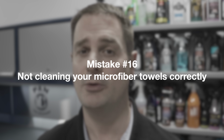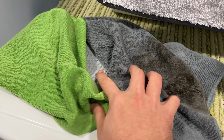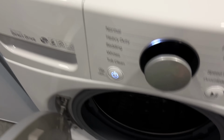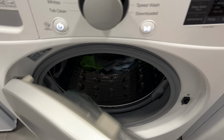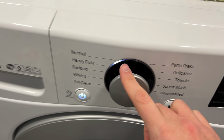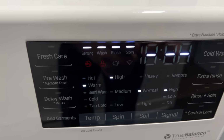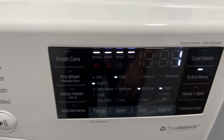Tip number 16 is to clean your microfiber towels and your microfiber wash mitts correctly. That is very important. Now, there are a bunch of tutorials on that. I have a few microfiber cleaning tutorials on my channel if you want to check that out more in depth, but basically, you can wash them in warm or hot water if you want, that's fine. If they're not that dirty, use cold water. But when you're washing them, do not use any bleach, any dyes, any scent additives, and that kind of stuff, and especially no fabric softener. That is key.